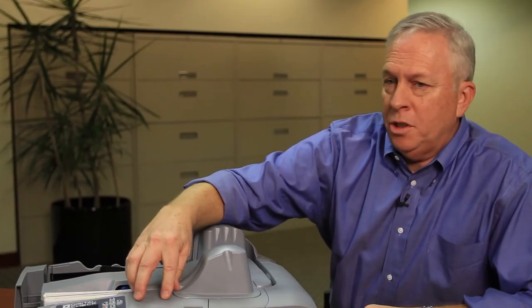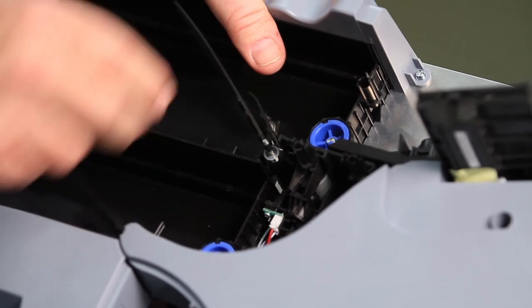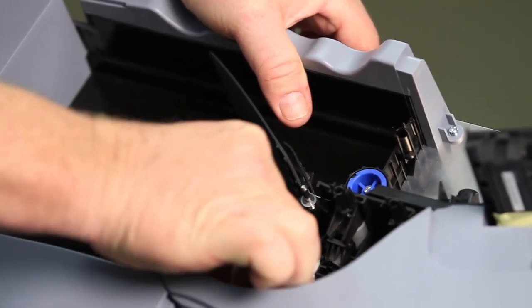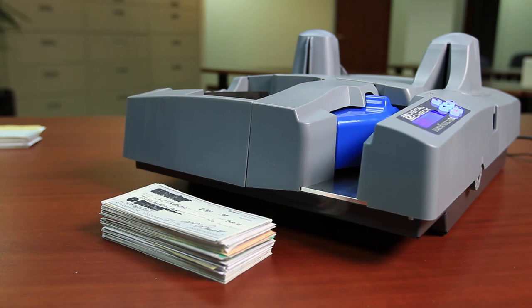There's a set of replaceable rollers inside the scanner — three in the entry area and two in the exit area. These are color-coded with a blue top on them, and they are replaceable at a service increment of about a million items, to help compensate for wear on the rollers. The scanner has the high capacity and reliability that you're looking for. For additional information not covered here, take a look at our user manual and follow up on the website.